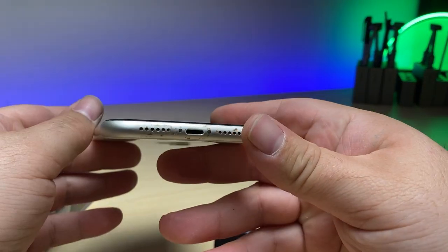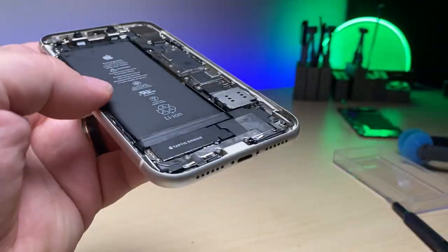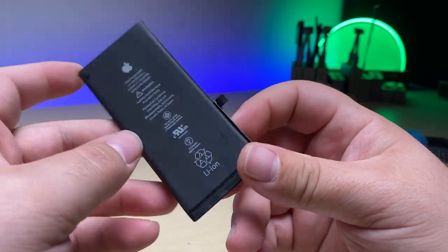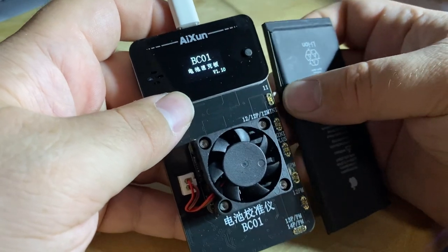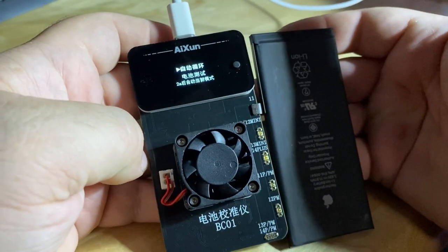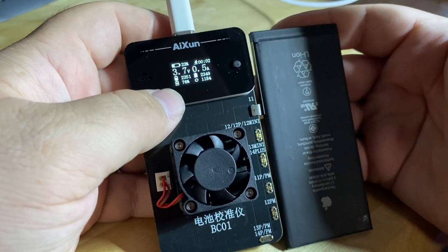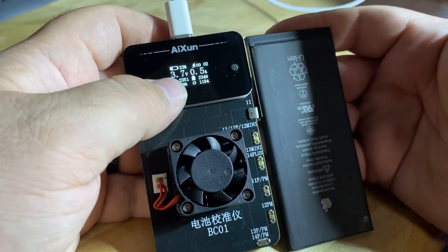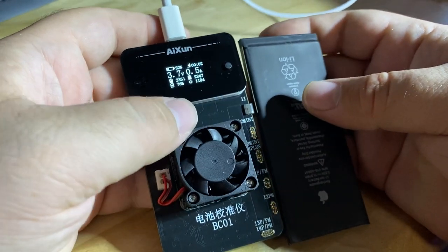Go ahead and turn off the phone and take out the battery. Now we've got the battery out. We can connect it up and see what it says. Here you can see the battery capacity, the charging state, the current state, time, the actual capacity, the full charging capacity, the health, and the cycle counts. I've got this hooked up to the computer and upgraded it. Now we'll connect the battery. We can see it has the cycle counts and the battery health percentage — it actually says 76 instead of 73, which is interesting. It shows the battery percentage at 31%. Let's go ahead and refurbish this battery and see what this can do.